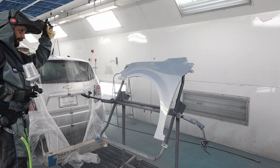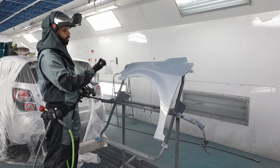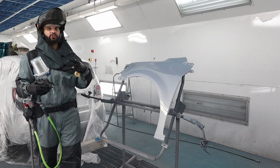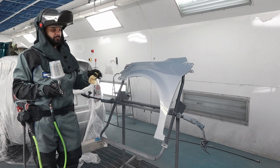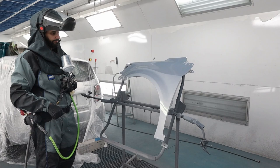As always, edges first. I have the booth set at 70 degrees so I'm not doing double coverage coats — I'm more comfortable doing single ones. I'm laying it on nice and wet, tight overlap helps to avoid striping. That's pretty wet — it'll take probably 10 to 15 minutes to flash off. You could also use a fan blower or venturi blower. I'm not an expert in this, I've just sprayed gallons and gallons of it and I'm just trying to share my experience.